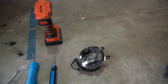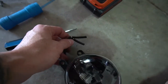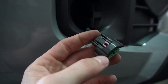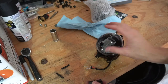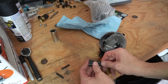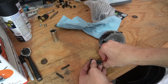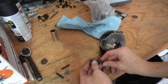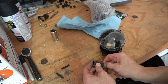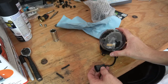On these fog lights, the green wire I have read as positive — these don't come pre-assembled, they provide you with a plug. So make sure you put the positive to the green wire. Grab the clip, get it lined up — you want the red wire going into the right-hand side as we just tested. It plugs right in. Make sure the rubber grommet goes all the way inside — that went in pretty well. Hit the negative side, and everything's in there. You'll probably hear it click and that's how you know it's in far enough.